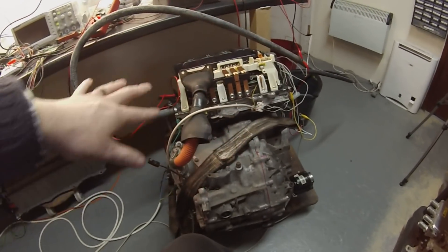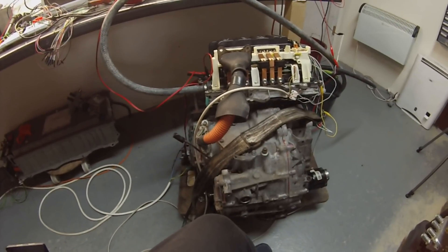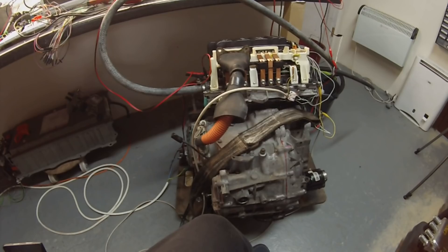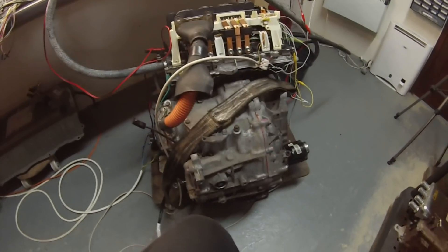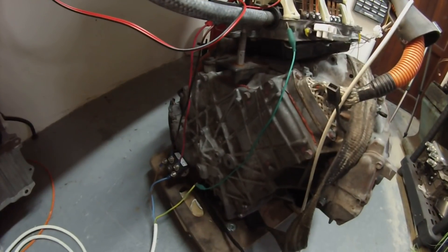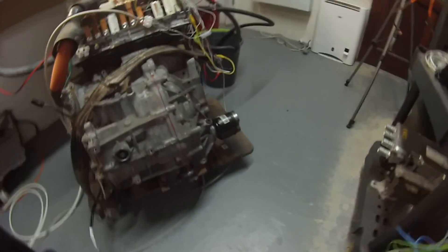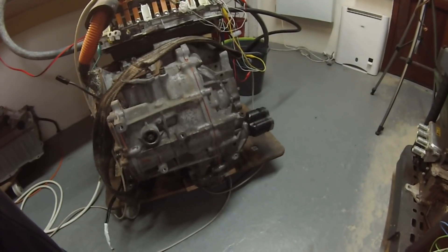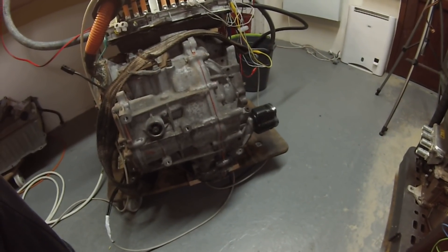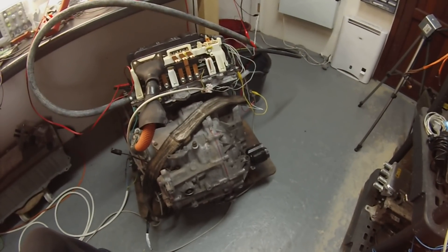We still have to go ahead and get MG1 connected up and get the two of them pulling their weight together. I'm very interested to see that it's quite important with these permanent magnet motors, particularly, to ground the casing. Otherwise you'll get loads of noise on the resolver signal and you don't get to drive along in your automobile. So that is about it, guys.